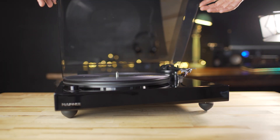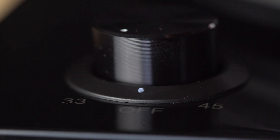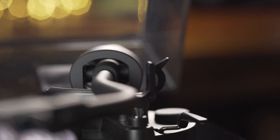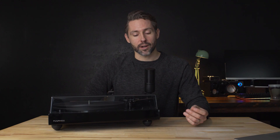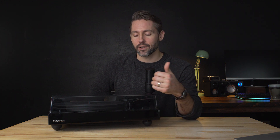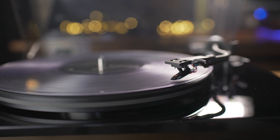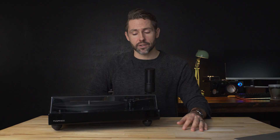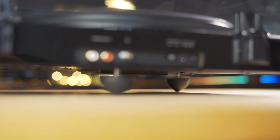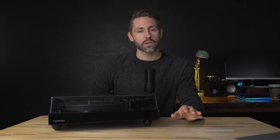Because of its pure analog construction mindset, operation is pretty manual as well. Once set up, to start playing a record: place the record on the aluminum mat, turn the motor control to the appropriate speed, unlock the tone arm lock, lift the cueing lever, move the tone arm to the desired starting point, and drop the cueing lever. There are lots of turntables where this is more automatic — even the Audio-Technica LP-60BK just has a couple buttons for start and stop. But I don't think vinyl and analog purists will mind the manual nature of the RT82. The reference turntables also have three adjustable rubber vibration-isolating feet underneath so you can level the turntable for the best playback.